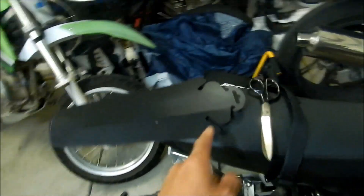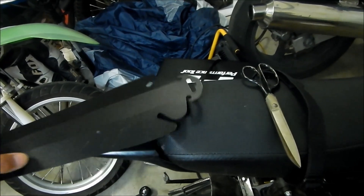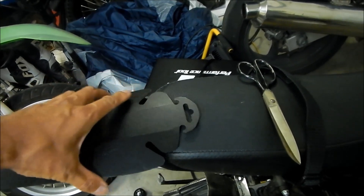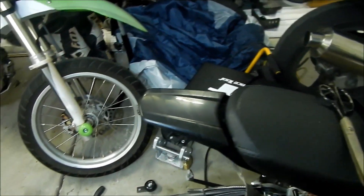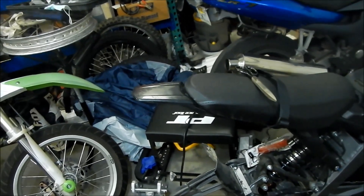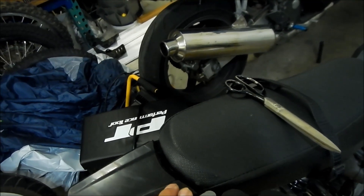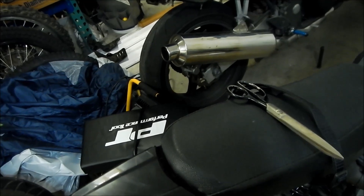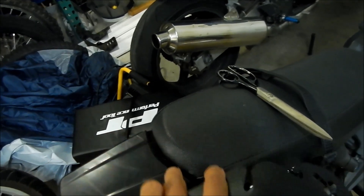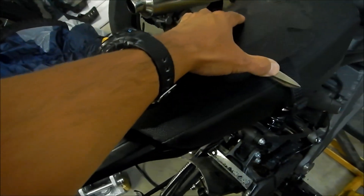The first thing to do is trim this so it fits right on top. We're just going to chop this part off first with scissors, cut it straight, and try to cut it as close to the stock fender as possible. I could take the fender off easily, but I don't see a real need to. So we're going to cut this to fit, then go drill maybe six holes in this. Yeah, let's do six holes — four here and two in the center. We'll rivet it together.